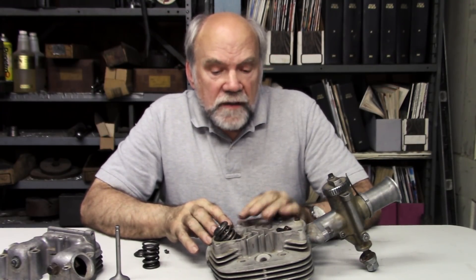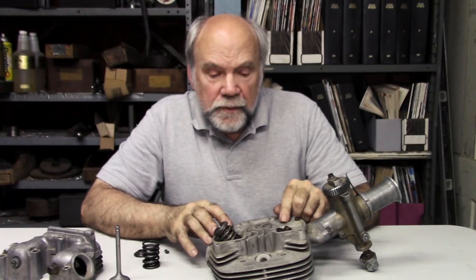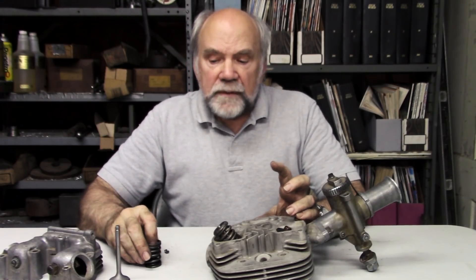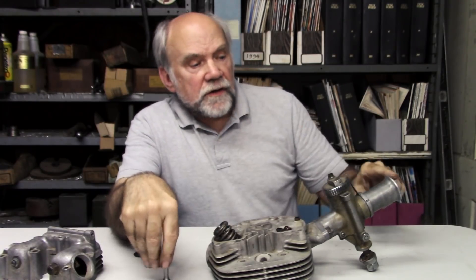So this is the basics of how four-stroke — or any — combustion can be rapid: the intake process involving flow at hundreds of feet per second stirs the fuel-air mixture and enables it to tear up the flame kernel created at the spark plug and distribute it around the cylinder very quickly. If combustion were much slower than it is, these engines wouldn't be able to operate at 6,000 RPM. But thanks to turbulence, they can. Turbulence is what spreads the flame in the combustion chamber rapidly. There's a lot of science to the shaping of ports and valves in order to allow maximum intake and exhaust flow.